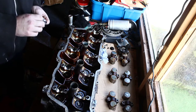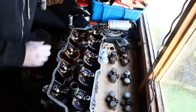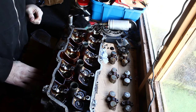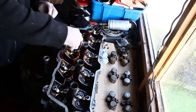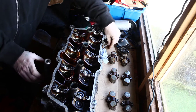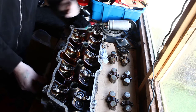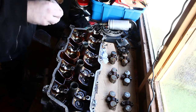This would be an ideal time to do the valve seals as well, but if I'm honest I'm in quite a rush to get this done and I haven't been able to find anywhere with them in stock. So we'll see how it goes — hopefully these ones will be okay. That's the new spring in. Place the collet on top, insert the keepers. This part of the tool should slide in there and spring-load it. Put the keepers in as you normally would.